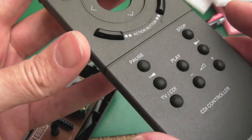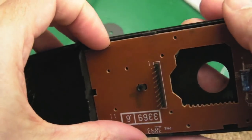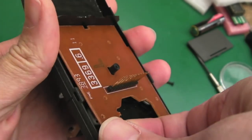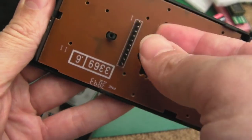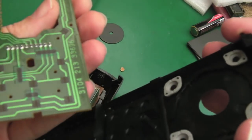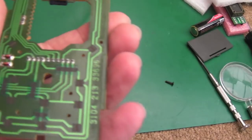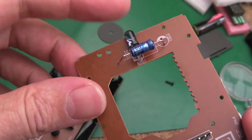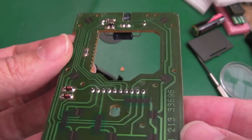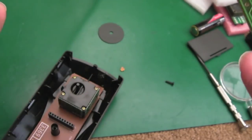I don't see any screws holding it on. Is it clipped in somehow? I'm going to say it's glued in. There we go — a bit of effort to get that out. So yeah, you can see we can just clean up these contacts here and clean up the PCB, just with some IPA. You can always swap out the IR diode there — if your remote stops working, chances are it's going to be that diode, assuming you've tested your batteries and your battery connections are good. But there's nothing else on there, no chips or anything, surprisingly.